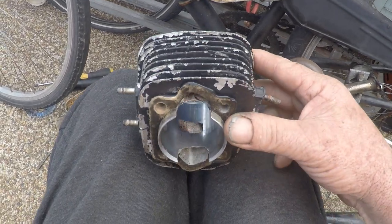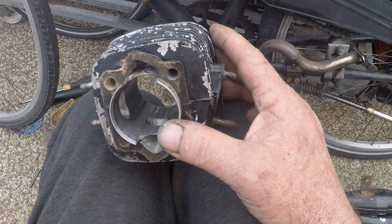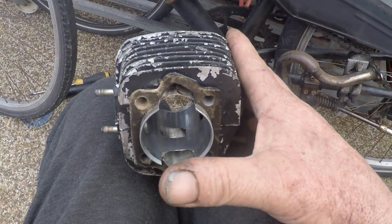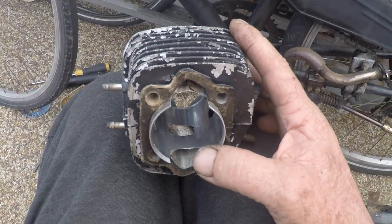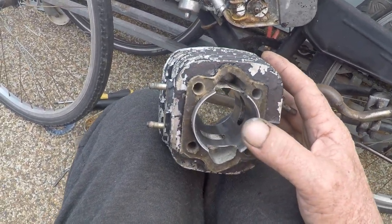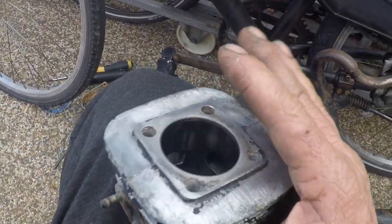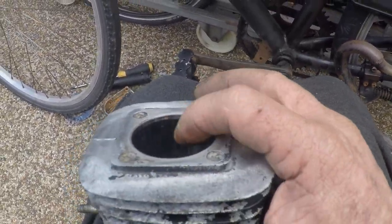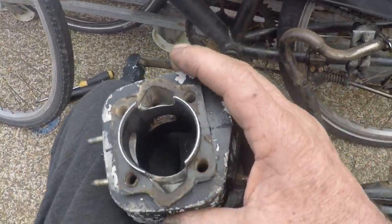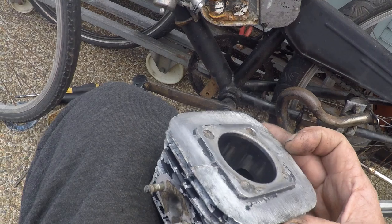The other thing is, you've got to have bottom end compression to be able to burst. The whole trick of a two stroke is burst pressure, so don't go opening up the bottom end and channeling and drilling and driving big grooves everywhere, because all you're doing is lowering your compression. When your exhaust is rushing out a little hole, there's still a lot of pressure in there, and you need good bottom end pressure to help push your exhaust out.